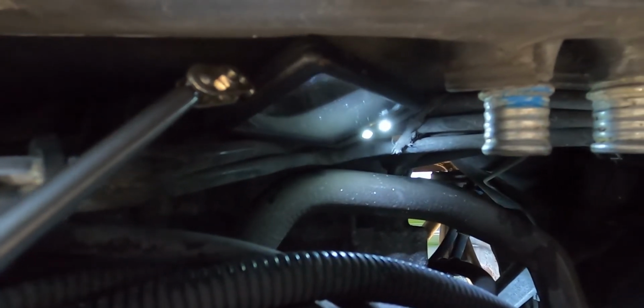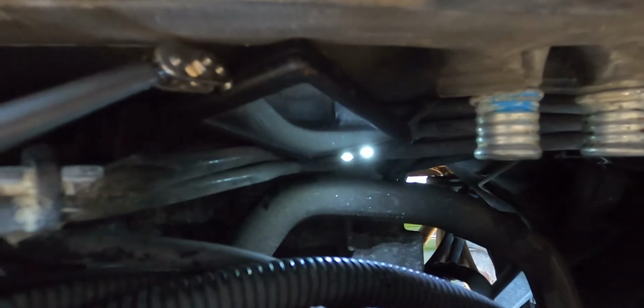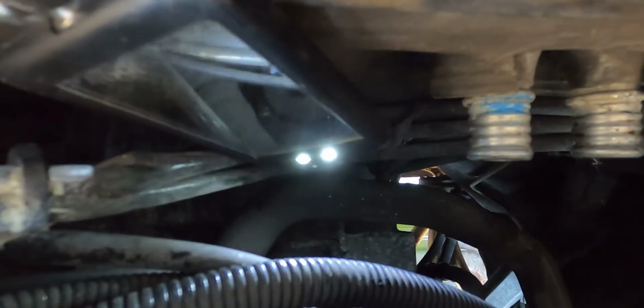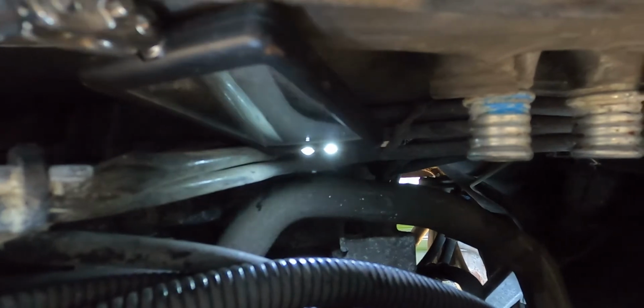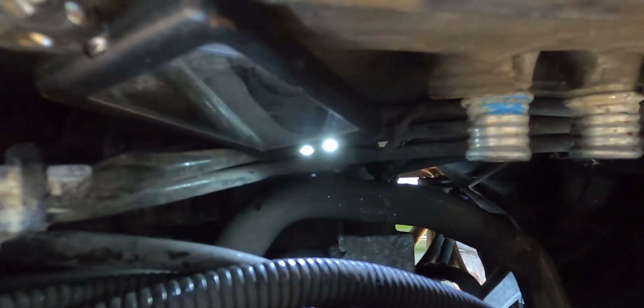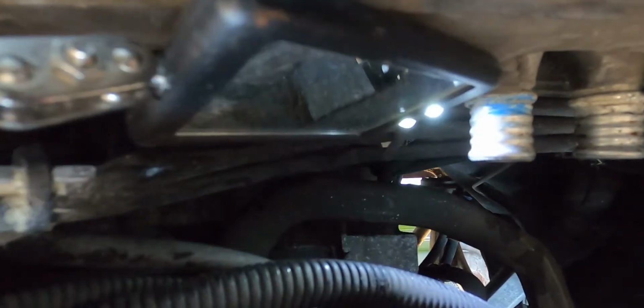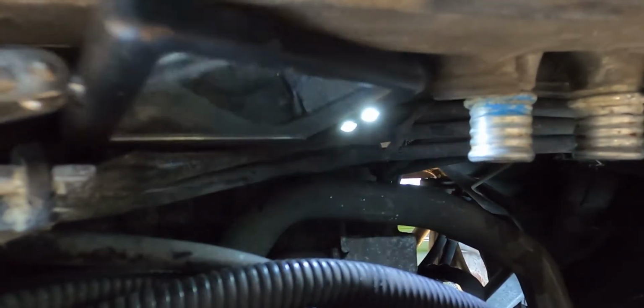Yeah, try that. So looking in, lift it a little, put your handle lower, yeah. So looking in the mirror, I don't know if you can see where that elbow pipe goes in towards the engine. It's just a spring clip style clamp like the other end of the last hose we did. So I can see looking in the mirror where the end of it is that we have to pull up. The challenge is going to be getting a tool in there. So we're not going to be able to film this, but maybe Mitch will set up the tripod just as an overview while he holds the mirror for me, and I'm going to try and release that spring clip.